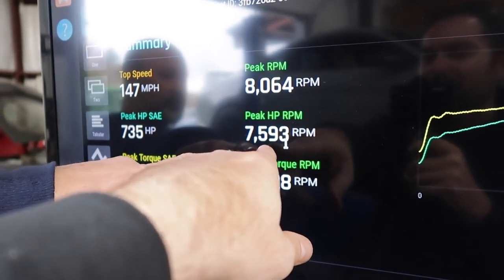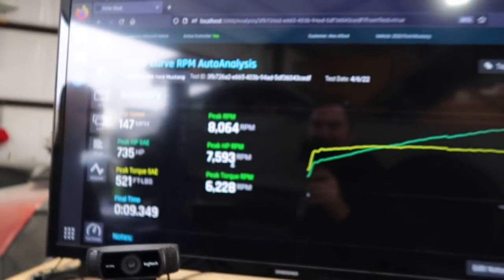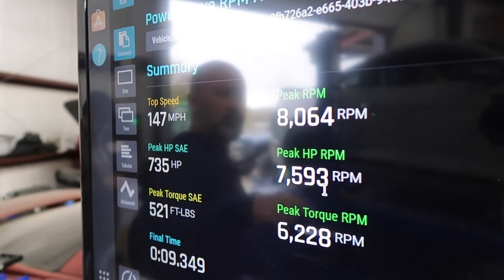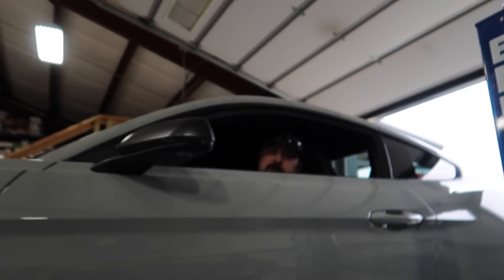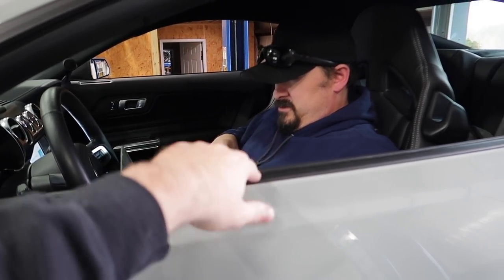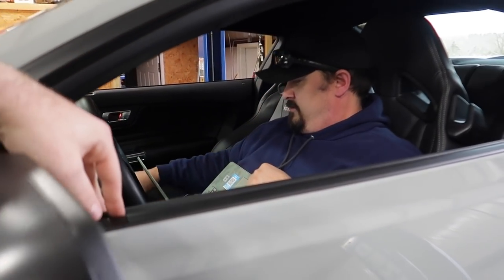Oh, you only went to 200 RPM lower. Why is it where it went in the cat? Oh yeah, we went to 8, okay. Yeah, it went in the cat over temp protection right above that. It would have made more than 735 if it hadn't gone to cat over temp. Yeah, protection, so... You can't turn that off. Right, no. Turn that off, that's how you get melted catalytic converters. No, we got to keep everything safe, so...